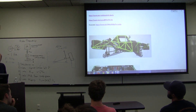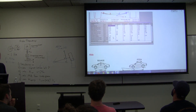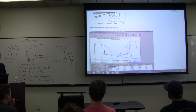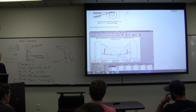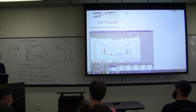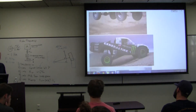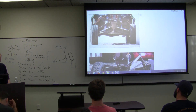In road racing, you get a double arm setup. Here's the lower ball joint and the upper ball joint. For forces, we like that lower ball joint to be as low as possible — the higher it is, the bigger the force on that joint. But there's just a physical limitation of ground clearance in these off-road cars, and so they're putting their lower ball joint pretty much at wheel centerline.